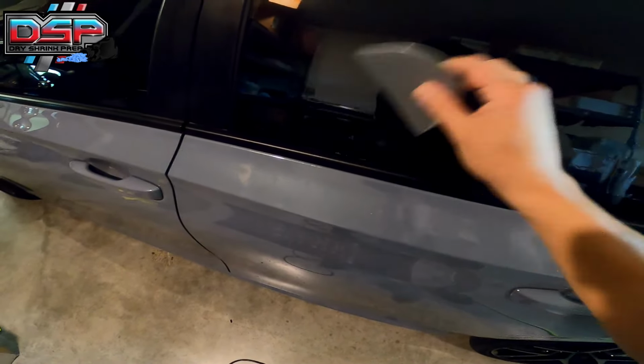Okay, so we've got those two fingers down. Last finger here. Sometimes you'll get fingers close to the edge. Notice that the film overlaps right here and it's overlapping the frame. If you get a finger close to there, what I typically do is, while I heat it, I'm going to put my card right here, and that's going to block any of that heat.